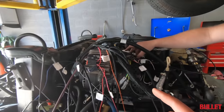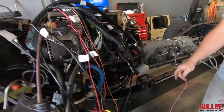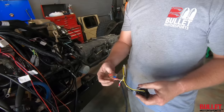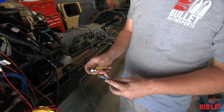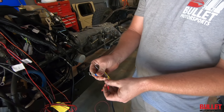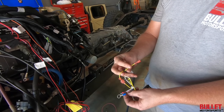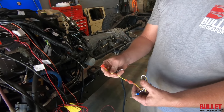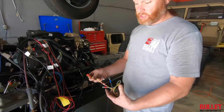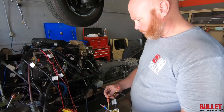We're going to take the RPM from the crank position sensor. Yeah, and they give you a box. They give you a module here for your tach. And all it is, you got a signal wire here, and all that feeds into the box, and then you got the ground. The only other thing is it has a tap, so you can run that signal to something else, like an ignition system or something in a gasoline. So you got a gasoline engine.